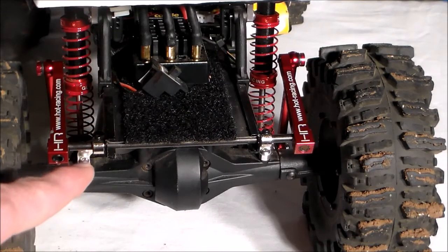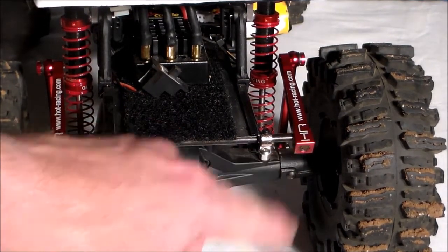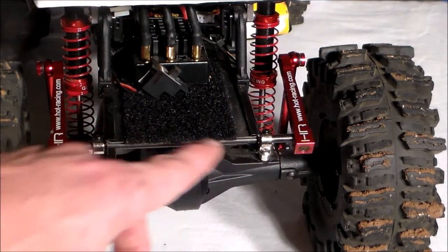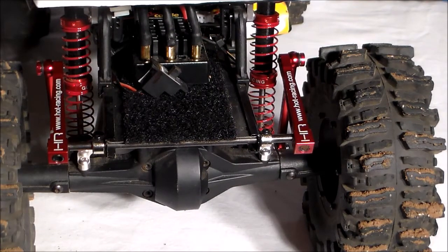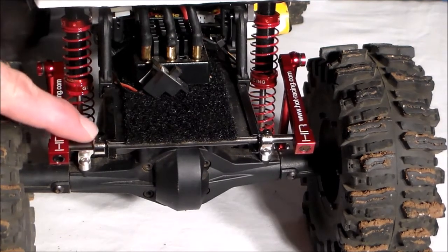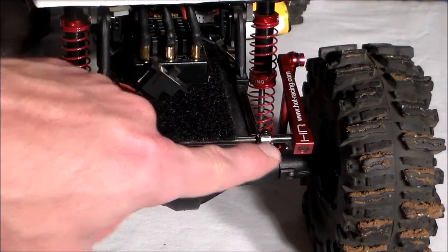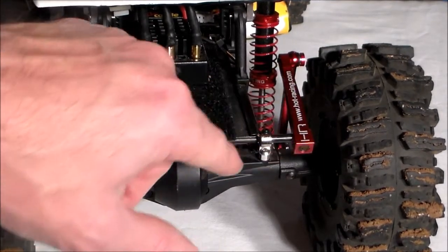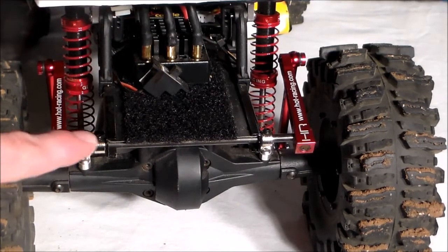Your calipers are going to come in really handy when you get this thing bolted down. You want to measure from inside this arm to the outside of the chassis - you want to make sure that distance is the same so that your bars are centered. Once you get everything bolted on and in place, tighten everything down, tighten the collars down. Then take one collar off at a time, just loosen it, slide it out of the way. What I did was take a Dremel with a little grinding disc - very small one - and grind down a little flat spot right there. You don't have to worry about it moving - you've already taken your measurements. Keep pressure on this side because that collar is tightened down. Tighten this one down, do the same thing over here. Take it loose, slide it out of the way, keep pressure on the bar, grind it down, you'll be good to go, tighten it all back up. Use Loctite on all the fasteners.